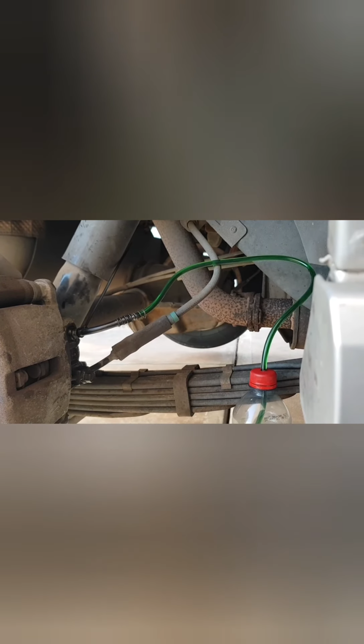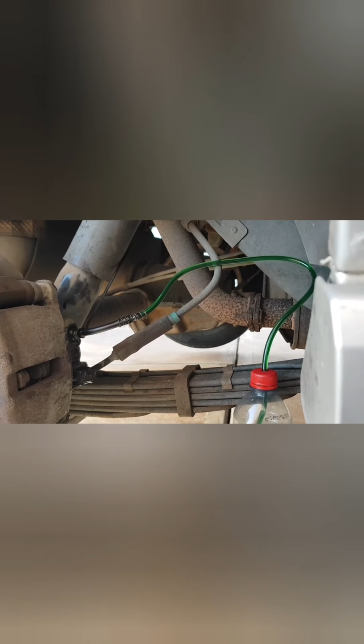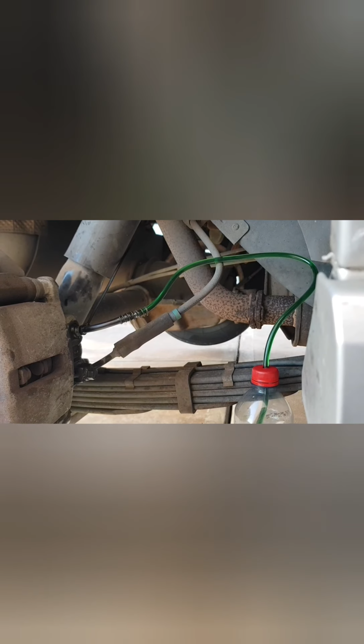I'll be right back. Okay, guys, so what I realized was I only had 1 foot on the brake, 1 foot out of the car. I wasn't able to actually depress the brake pedal with much force, so we weren't getting enough pressure in the braking system with the car off. It was just manual hydraulic pressure. There wasn't enough to bleed the system. Now we can see there's constant fluid flow. I recommend sitting in the car and braking all the way as much as possible, and then I actually felt the resistance that I wanted. So I'll just return once things are looking a lot more flushed.